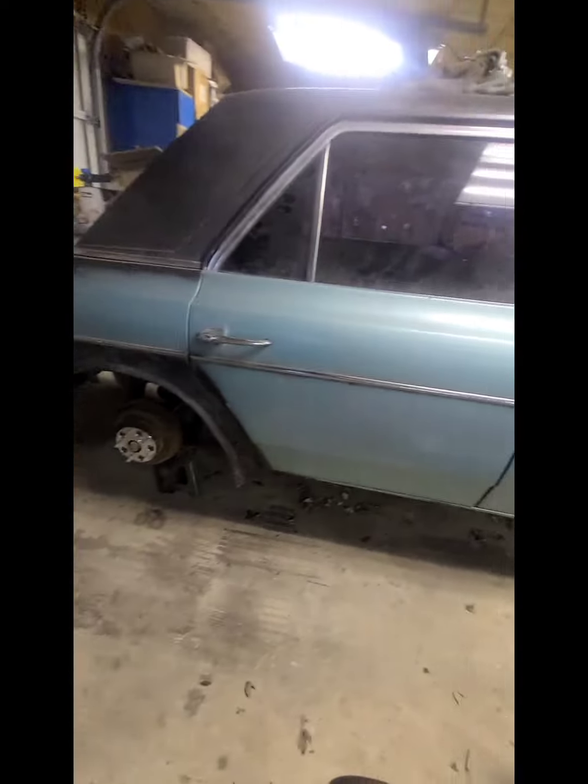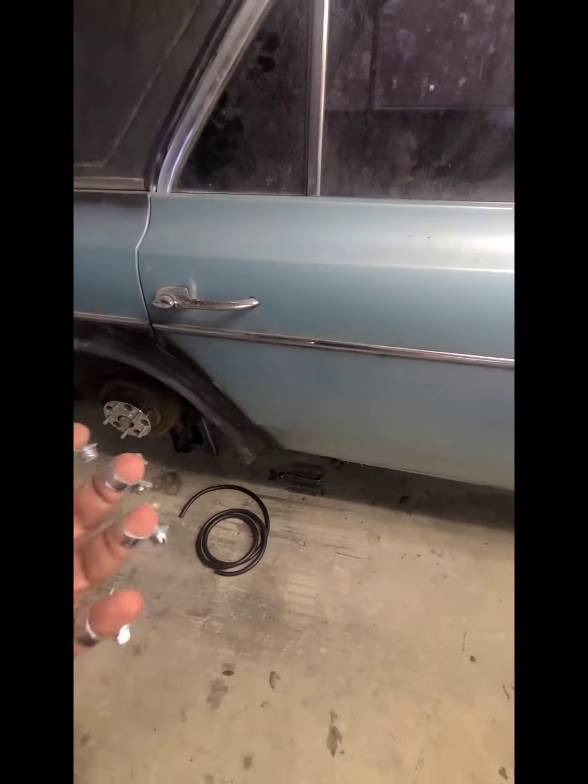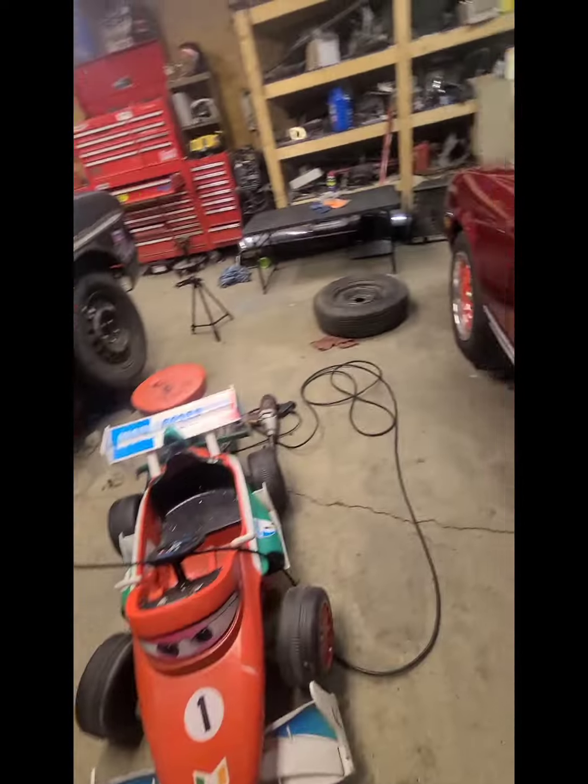All right. I guess the next task is going to be get ready to climb under there and take two of these with me, and a screwdriver, and get to work. Not the easiest thing to see or do, so I did it off camera. Sorry about doing so much off camera today, guys, but it is what it is. New soft line ran from the tank to the original hard line. The original hard line I blew through, and it does seem to be okay. So, hopefully that is still the case, because I really don't have to replace it, too. If I have to replace that, that'll be the end of this video, because I am not going to lay down here and get soaked in gas and buy a line I don't have the money for at the moment. So, yeah, now to go up underneath the hood and get that one done.